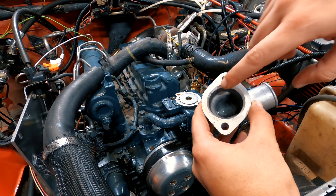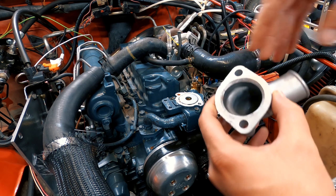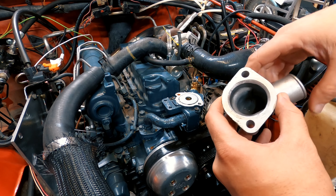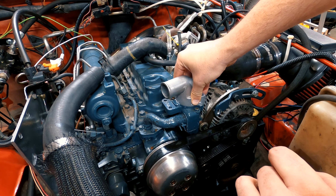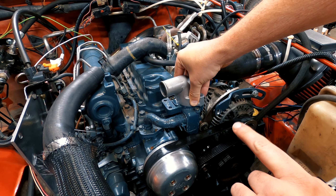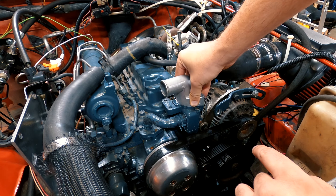I've been grinding against the housing at an angle so I could still apply pressure to the washer, and I went really slowly, keeping checking with the washer to see how deep it was going. I think I could take off just a hair more because it still bounces a little bit, but I'm going to try putting the gasket on it and tightening it to see if it won't seal, because I don't want to take too much material off.